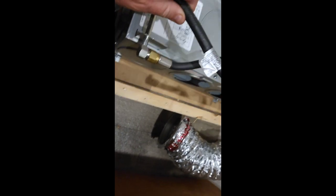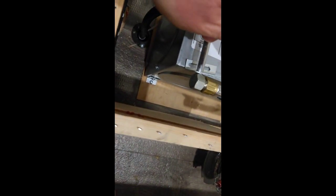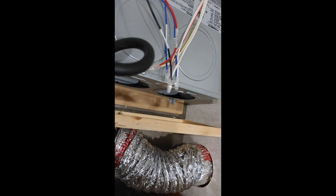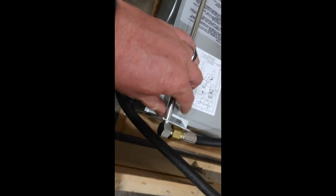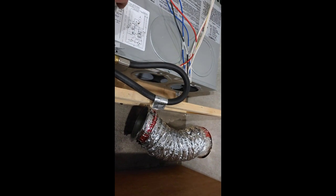Two of the things you have to remove to get the furnace out is a screw here and a screw here. I'm actually putting the furnace back in, so I'm filming this in backwards order. I just put those two screws back in. Next thing I'm going to do is put the ducts on, and then last but not least I'm going to put the little set screw that holds the propane in place. I'll leave that undone until I get the ducts back on, so we're going to slide both of the ductworks back in.